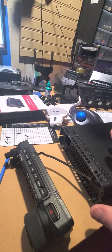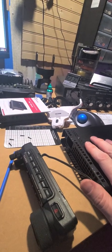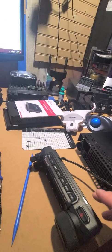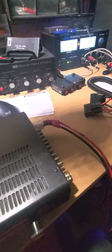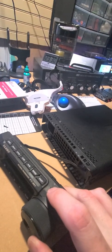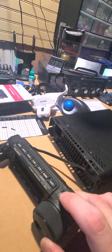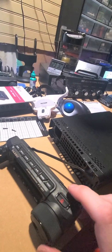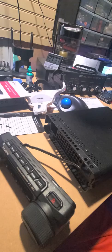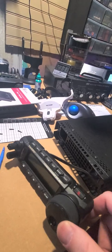I thought maybe it's the power cable, so I checked the FT-891 and nothing with the 891 either. Here's what I get with the 891 — I've got it connected to my power supply, fuses are good. I press and hold the power button, get one click, press a second time, get another click. It sounds like a relay but I'm not sure. I just wonder if anybody else has had that problem and whether it can be fixed or if it has to be sent back.